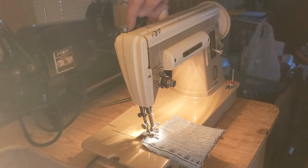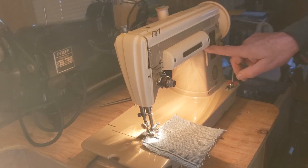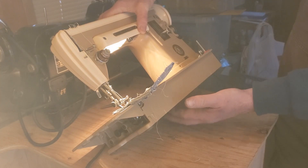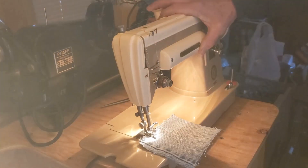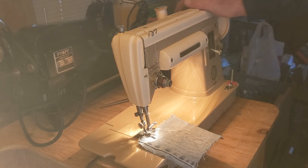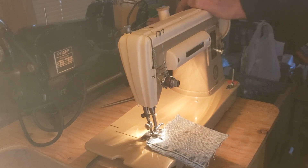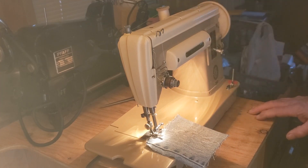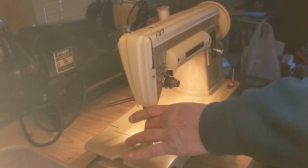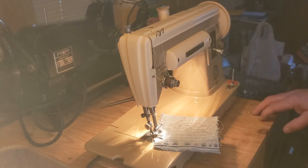There are oil holes that you'll see in various places on your machine. There's a cover on the bottom that you want to take off, and you'll be able to see the movement points down there. Every movement point where they actually make contact will need a drop or two of good quality sewing machine oil. You also have a user manual — read the oiling instructions, that'll point out all the important spots to oil. Every other oiling, take the needle plate off — there are two screws that hold it on — and brush out the lint and dust and crud that collects under the needle plate around the feed dogs.